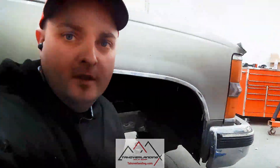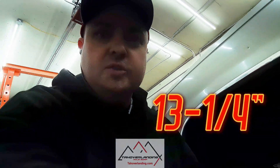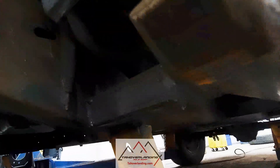This one always triggers people. What we've got there is a plank of wood and the coil springs being sandwiched between the plank of wood and the ground so that we can see what the coil springs will roughly compress to under the weight of the front of the vehicle — giving us a good starting point on where to weld the coil mounts to the frame. You don't actually need to do that, but it's barely off the lift arm, so if this thing were to fall at all, it's not falling far.